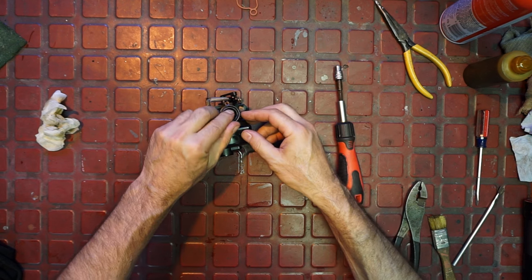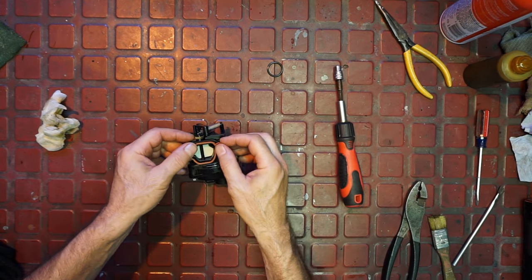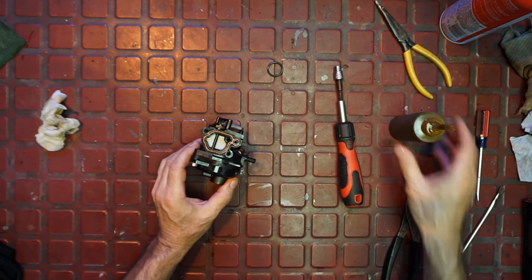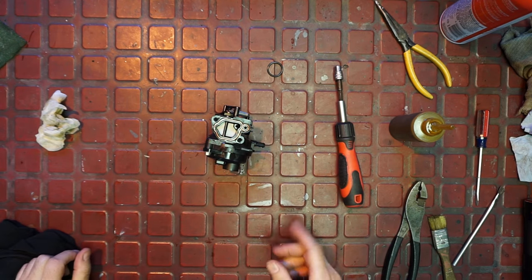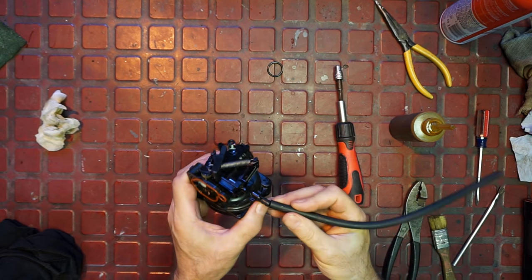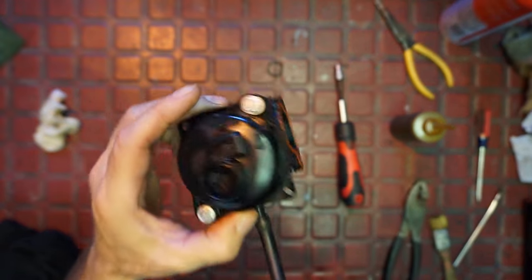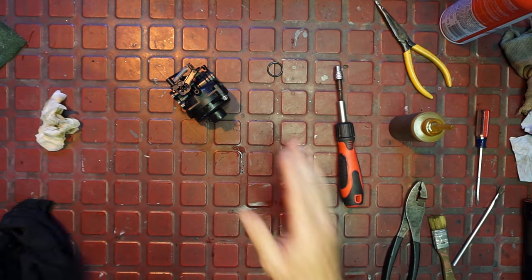We'll put this O-ring back — we're going to put it on the tube. This is its normal position. I'm going to blow in and you'll hear air go through the float. Now I'm going to flip it upside down — no air goes through. So at the very least, simple test: the float is sealing. Let's bring this over and get this thing on. You see this white thing — that's a retainer. We want to put that O-ring back in — the black O-ring — push it down all the way to the stop. Then this retainer goes in.